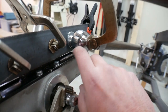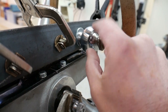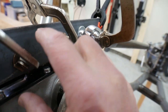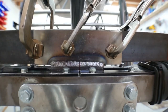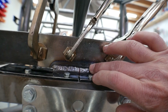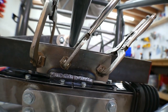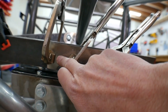What I'm going to do now is mark out this location because now I know exactly where I want this steering rod to be connected. I'm going to measure this all out and mark that up. Then I'm going to take this plate, trim it down, and get it to the proper length. I'll figure out my centers — this piece is permanent, I already welded this on there — and I'll weld that front plate to this plate and drill a half-inch hole for the tie rod.